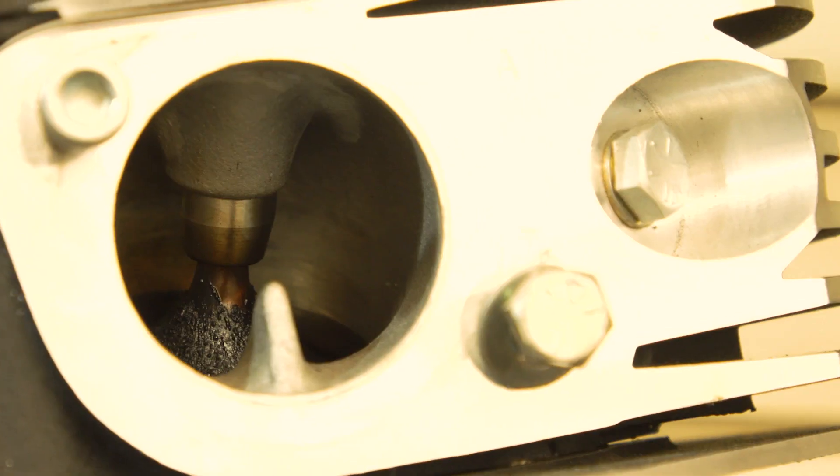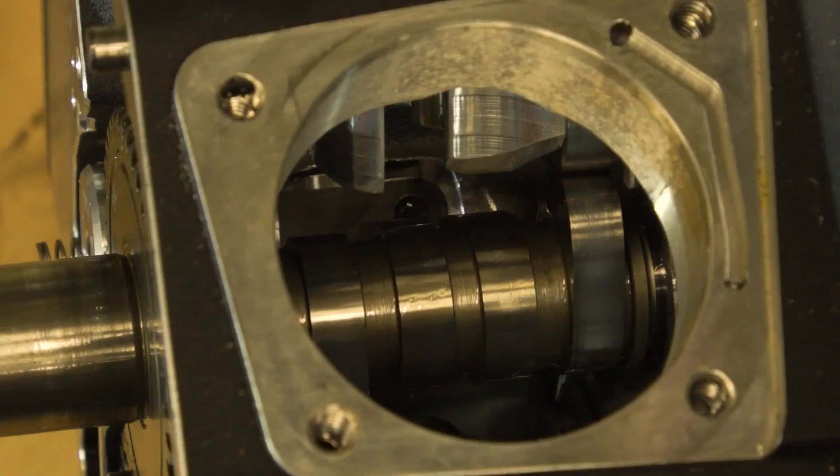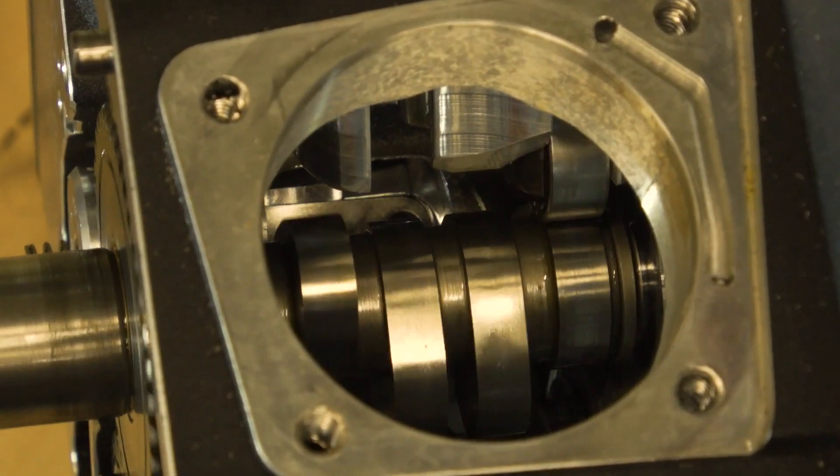That height is measured in inches, specifically in thousandths, and that's how much it opens the valve. When the valve comes out of the pocket and pushes out into the combustion chamber, that distance is the same as that lift on that cam. So if you have a 510 cam it's actually opening 0.510 inches and allowing that air through there. If you have a 585 it's going to be 0.585, and those may not seem like big increments but they have a big effect on your motor's performance.